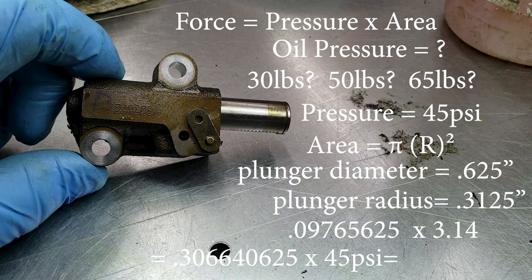To calculate the area, area equals pi r squared. The plunger diameter is 0.625 inches, so the radius is 0.3125. Squaring 0.3125 gives 0.09765, times pi (3.14), which gives 0.3066 square inches. So 0.3066 times 45 psi is only 13.79 pounds — that's really not that much pressure. If those plungers get varnished up and sticky, and you also have the chain guides leaning against that plunger pushing it back in, 13.79 pounds is not a ton of force to overcome. So to me it makes sense that the varnish is really all that held that plunger from coming out. That's my theory — I could be wrong. What do you guys think? Leave a comment and let me know. Thanks for watching.